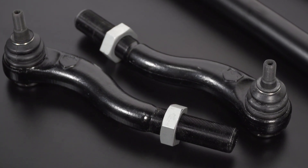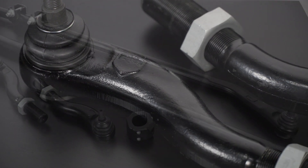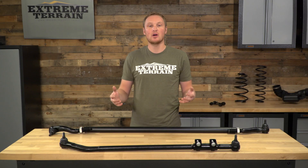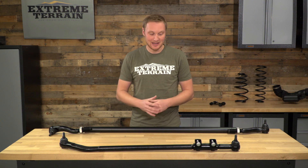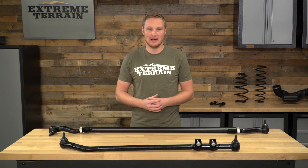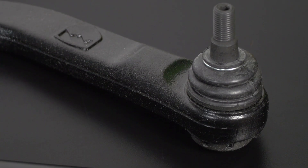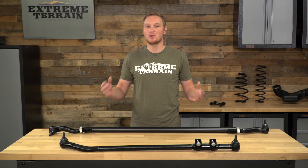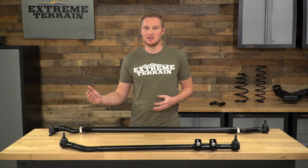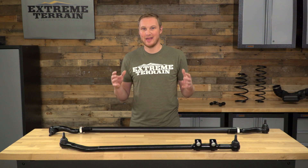If you do some hardcore wheeling with your Jeep and or you have really large tires on your Wrangler, a setup like this is going to provide a ton of strength. When you are off-road, the factory tie rod is very exposed and it's very easy to bang it into a rock or a stump and bend it, which can ruin your day of off-roading. And upgrading your drag link when you have large tires can get rid of what would otherwise feel like a wobble — you can actually have your factory drag link bend a little bit when you are off-road hitting big bumps with large tires. So upgrading to a much stronger than factory drag link will take care of that situation on the road.